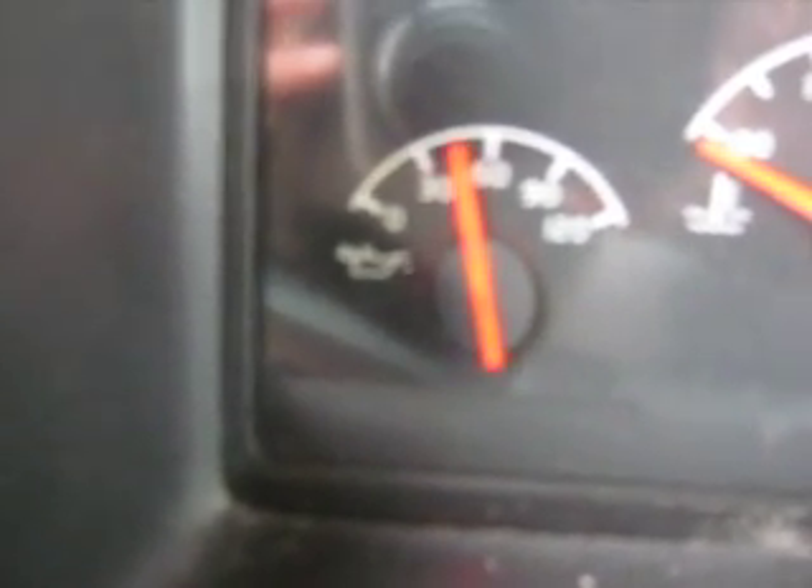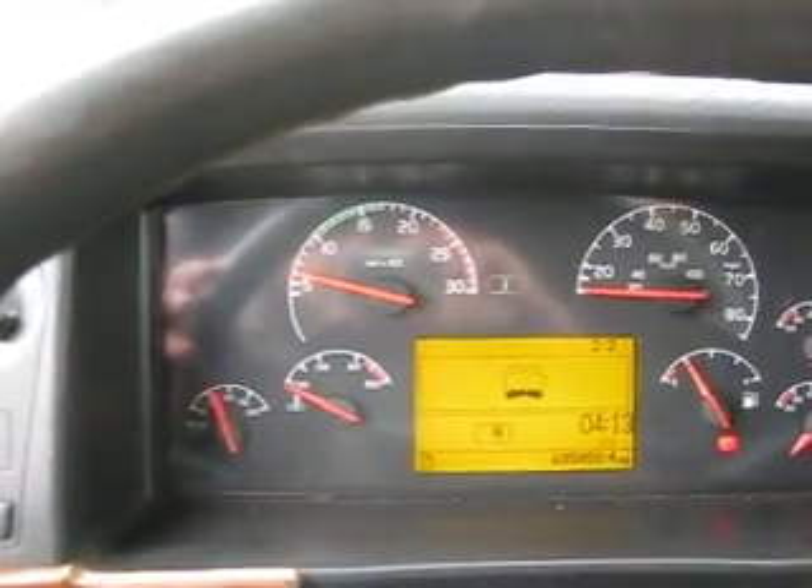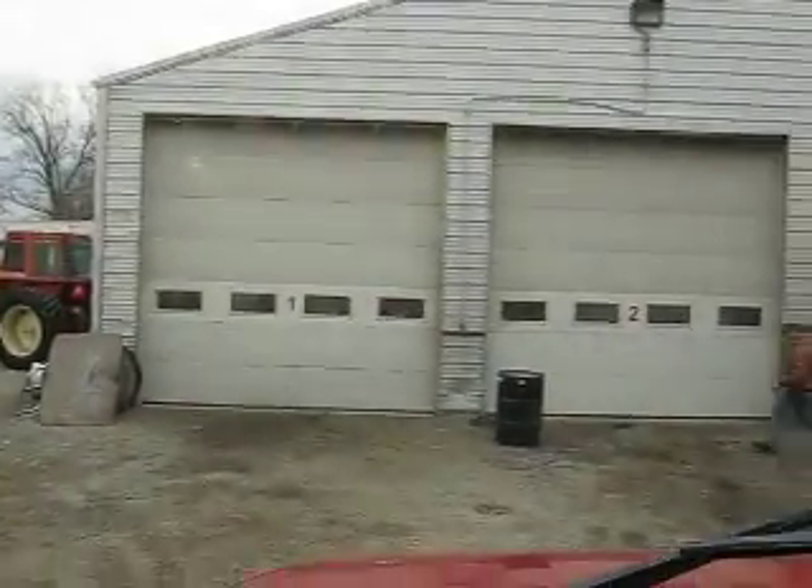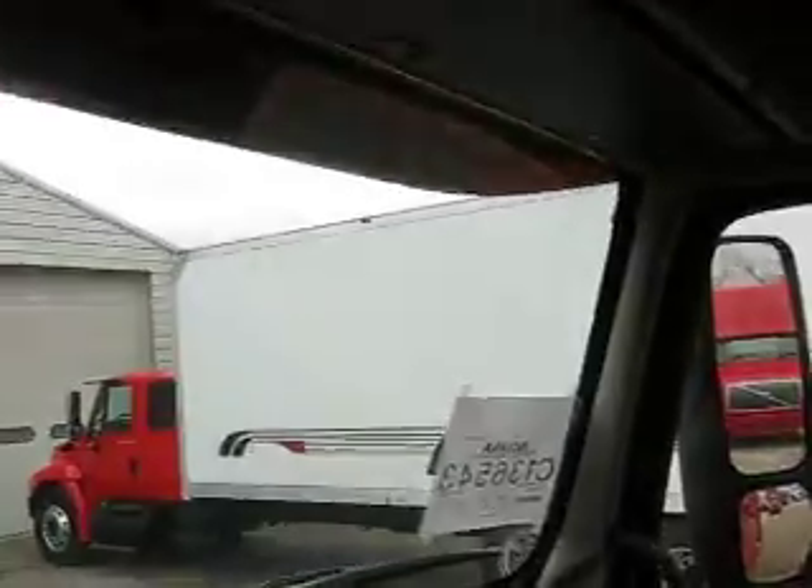I'm going to bring a little throttle into it — you can see it come up over 60. She bounces between 40 and 60 on oil pressure. As you can see, the dash is all lit up, the gauges are working, and there are no check engine lights on. You can see the mileage reading of 685,850, and that does match on the computer as well. We'll shut the truck back off so we can hear better. Starting right here across the top of the dash — it's very nice and clean, spotless as a matter of fact. We have very nice glass; there are two slight stone chips but no cracks, no breaks. It will fully pass DOT.